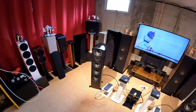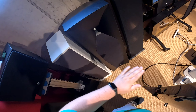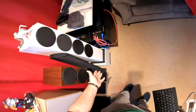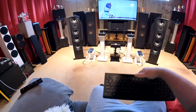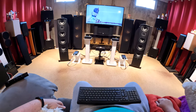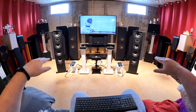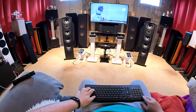Height dominance — that's why those Klipsch speakers are way up there, and why I like speakers where the center line is just under nipple height. My seven-thousand-dollar Buchardts are up on eight-inch cinder blocks because they're too low. These — when you sit down on an average couch — the tweeters are at the perfect height. They could have made them shorter; there's so much room they could have crouched them, but they didn't. The big ones are even bigger — RF7 size. You're going to get that tweeter at least at ear level or higher.